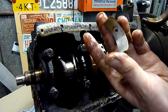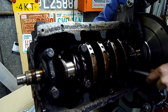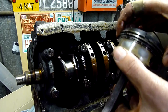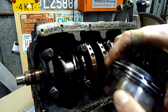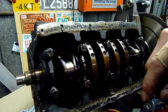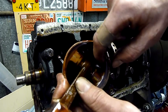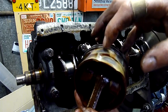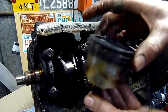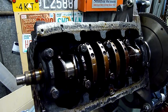If it was half-decent, serviceable. No smashed rings, they're still quite good. It's just these wear patterns that are interesting, probably also to do with heat expansion. As the piston heats up, these surfaces start to contact, especially here where this massive aluminium starts to expand and push the piston out to the bore — and that's why you're getting this kind of pattern, at least that's my theory. The wrist pins don't feel particularly loose on any of them — gudgeon pin as you also call it. Really interesting.